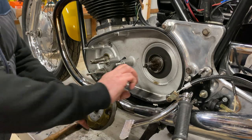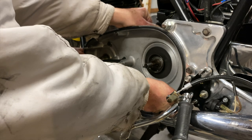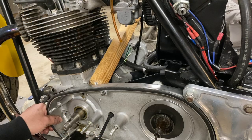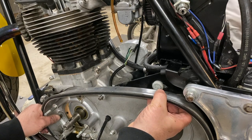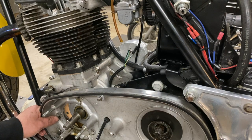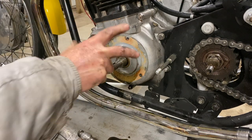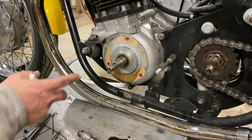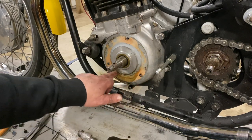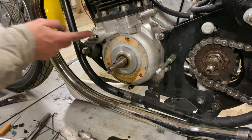We'll just snip this and then that hopefully should just lift away. That was a tight fit — you've got a gasket that's sticking it on there as well. I recommend you replace that seal while you're at this point, which I'm not going to do because I didn't buy a replacement. Plus this is a low miles engine — I would have put a new seal in there when I rebuilt the engine. That's dry as a bone though — you can tell it held on really well, it wasn't leaking at all. It was a nice tight fit on this boss here.